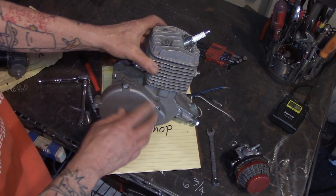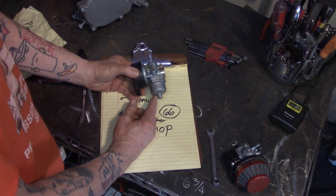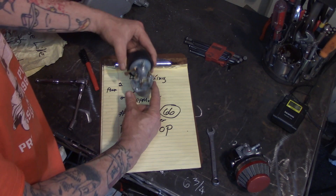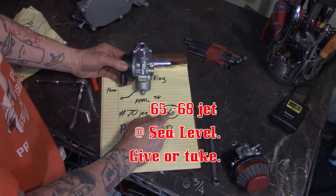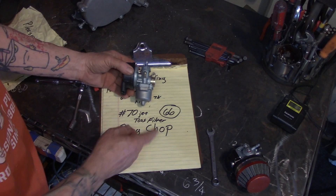That's just a limitation of the flow of the engine. One of the quickest fixes you can do to help things flow a little bit better is adjust your jetting. Stock from the factory, these are a little bit rich — they come with a number 70 jet. You remove the two screws on your carburetor, pull the carburetor, and the jet is underneath. You want to jet down to a number 66 at sea level for most engines. Bottom line, you want to do a plug chop after any tuning.